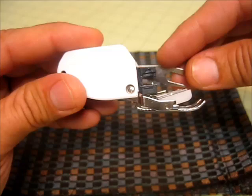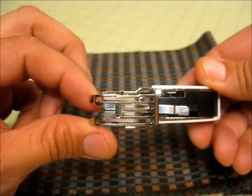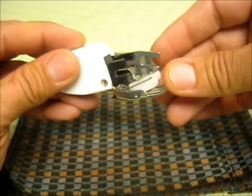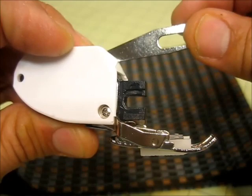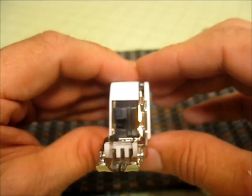To give you an overview, right here you have the arm that goes onto the needle clamp screw, and you've got this white foot that internally in this unit is attached to that arm. That's what the big white housing is at the back. When you raise the arm, the white feet drop down through. This arm is connected to the needle clamp screw which raises up and down every time the needle moves, and this is connected to the presser bar.